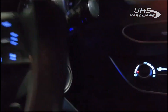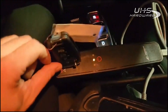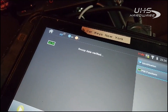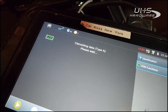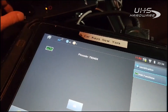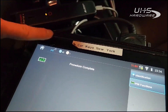Snoop capture successful. It's going to want the key back in the aerial. Authenticating... and there is a pin code for the car: seven nine three four nine four. Now let's see about programming it.